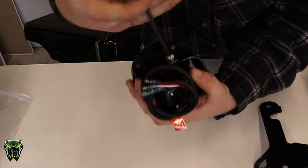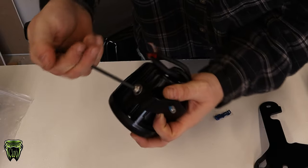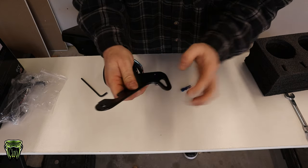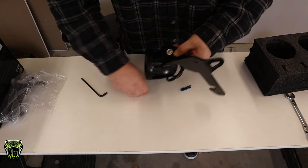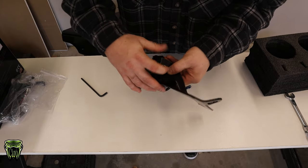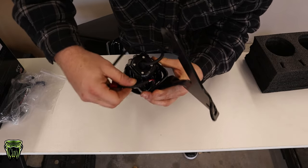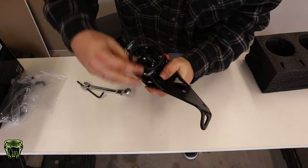Then all you're going to do is just snug these up. You don't need to go he-man tight with them at this point or ever, really — we're just going to snug them for now because once we get them on the bike, we're going to have to adjust them. Next, we have our big bracket — this is going to go towards the back of the bike, and the light just drops on top like that. The nut also has nylon on it, so just take a half-inch wrench and snug that up for now. This wire will go down in front through the bracket. You can do this before you put it on the big bracket if you want, but it does slip in there okay doing it afterwards.